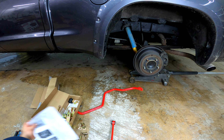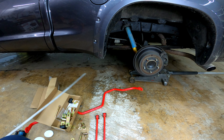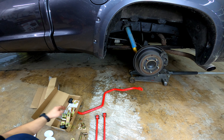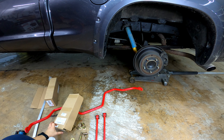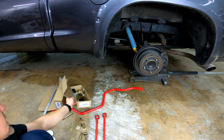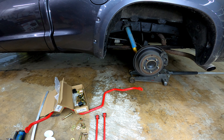To recap the most important things: tap out your holes — M14 by 1.5 — because you don't want to cross-thread or damage this when pulling the old ones out or putting the new ones in, especially in a rusty climate. And get your Energy Suspension grease. You can use OEM, it's fine, but it might wash out or dry out a lot quicker than the thicker Energy Suspension stuff. And if you want to save some cash and you already have a sway bar, just buy the kit, because the kit's a lot cheaper than buying the entire thing with the bar, just due to shipping and the size of the bar. Both kits were probably under $100 combined.